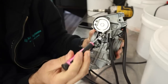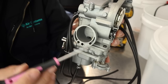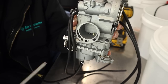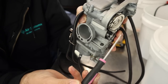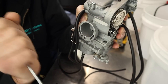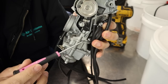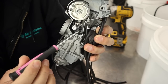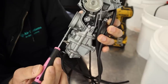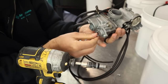Why does all this exist? Because four-strokes don't produce enough vacuum at a low throttle position or idle. The idea is that when you rip your throttle open, all this action over here happens — it forces fuel up through the orifice — and right off the crack of idle where the four-stroke has the most trouble getting fuel, this little guy squirts a nice stream of fuel in. In theory, that's what's supposed to happen when you crack the throttle. But due to the slack in this plastic cam, you still have dead space before it contacts the rod and hits the diaphragm. So I think we've found the problem — let's open this thing up.